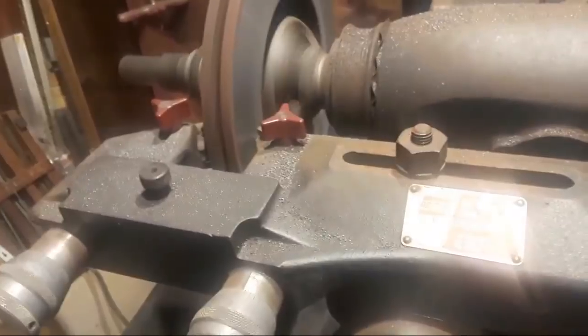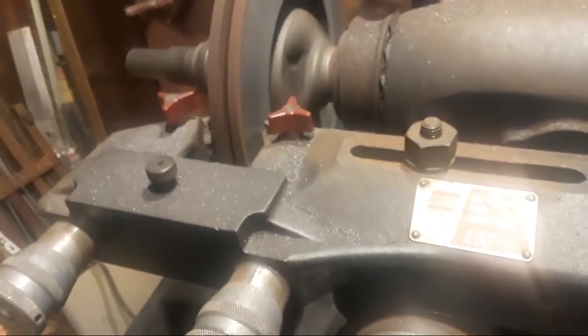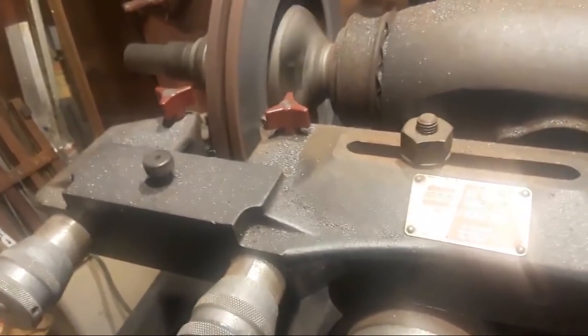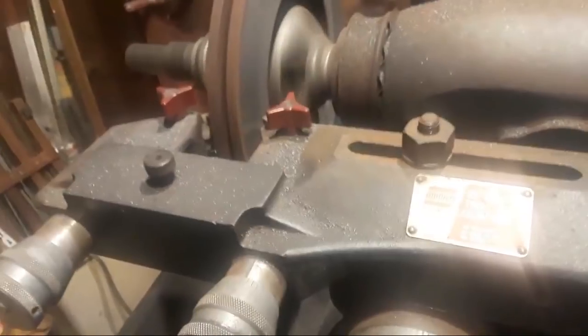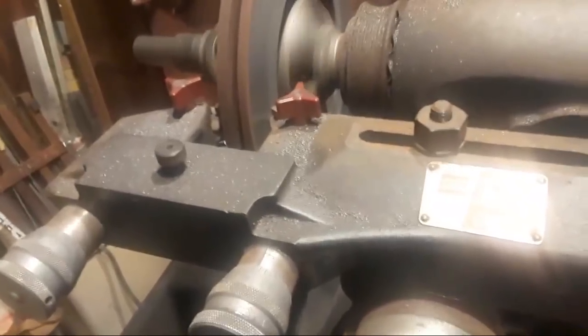Miss Char says they probably did the work unnecessarily, but what do I know? Not that they did it unnecessarily, Miss Char. Generally, if your rotors were too thin and not up to minimum thickness specifications, they are going to replace your brake rotors. So don't feel like you threw your money away. They did the right thing by you.